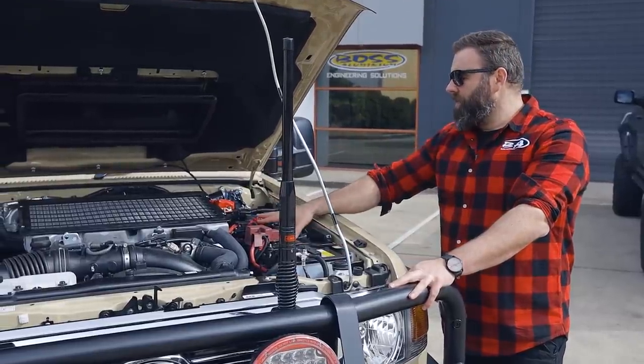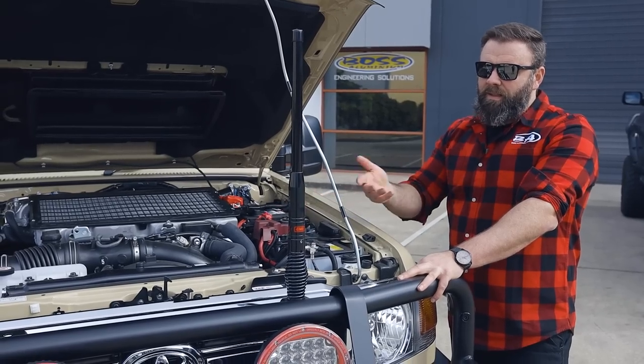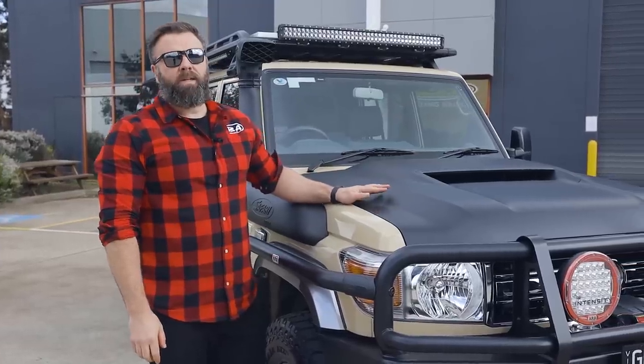The customer wanted the dual battery so that he's got an auxiliary battery that can jumpstart his front one if he needs, and also basically intermittently hook them together so that if he needs more winching power, he's going to have that supply there.